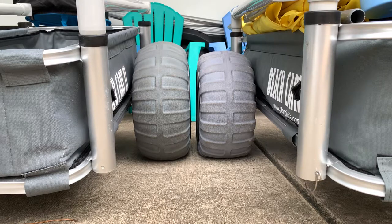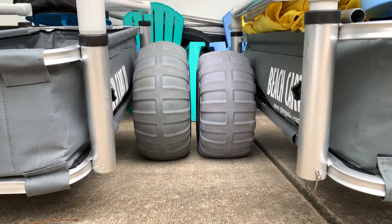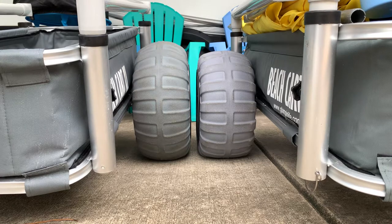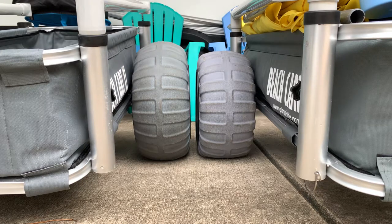These are not designed like a tire where there's a bead that they seal on. When you fill them up with air, these are like an inner liner, so you can't get to the inside of the actual tire. This is a good illustration: the tire on the right has never been over-inflated, and the tire on the left has. It'll never regain its form once you've over-inflated it. The profile of the tire should be almost like a square, not rounded like the wheel on the left.